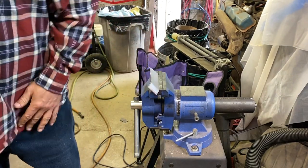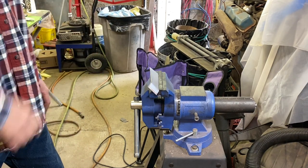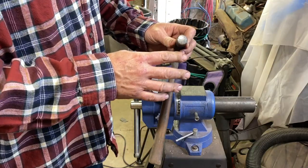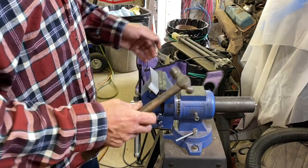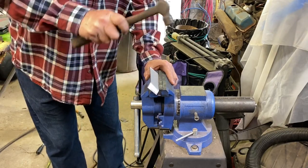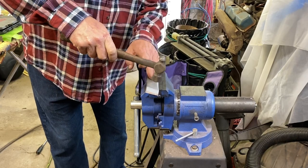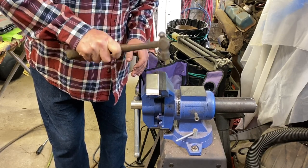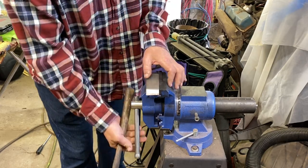I'm going to use my hammer and just finish that over. I'm not using any fancy hammer — just an ancient ball-peen. If you don't have body hammers, just take a file and surface off the face so it doesn't have any sharp burrs that leave marks in the metal. We'll take this edge and bend it over. Try to hold the hammer flat so you don't put dents in the middle. Then bend it down to 90 degrees, and then we're going to do the same thing on the other side.